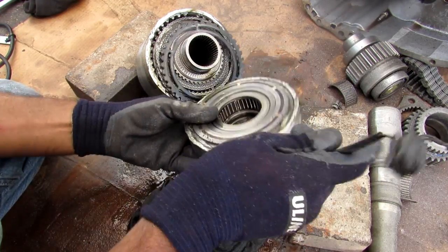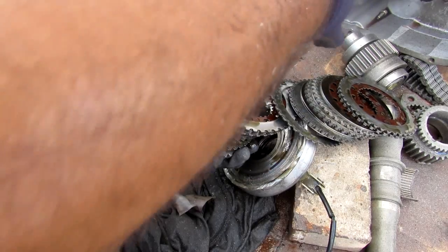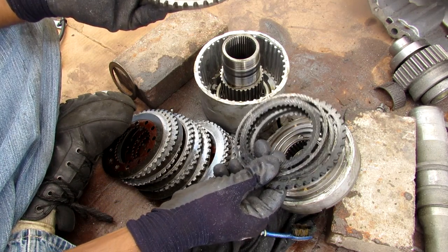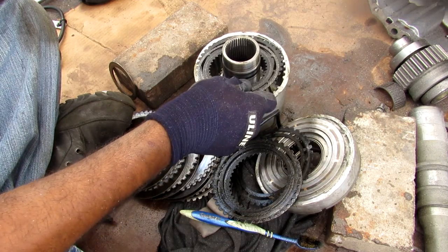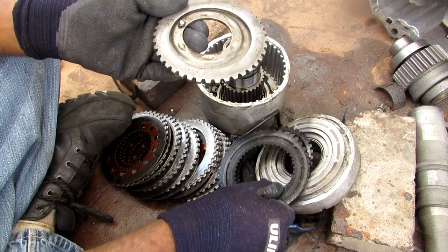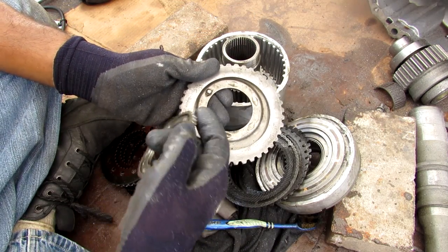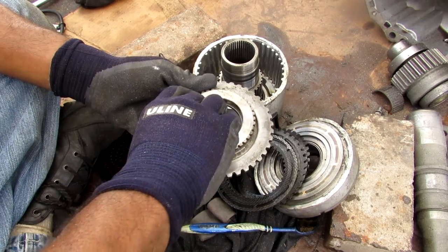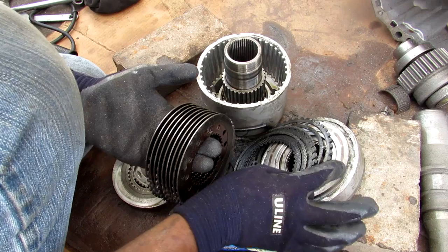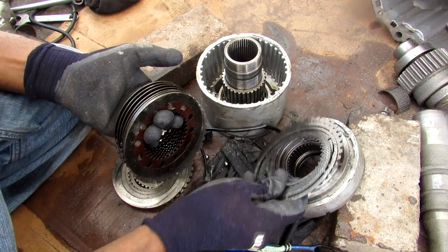This section looks like the clutch that actually does the activating because it has the wire attached to it. Here we've got the actual physical clutch — turning it upside down to remove all the clutches. The way this clutch pack works: the electromagnet activates and applies pressure. We have these control clutches sitting in front of it — some are externally splined, locking to the output shaft housing going to the front wheels; others are internally splined to this small ring. When the clutch activates, the output locks to this ring. But it's still applying pressure — and this ring has six ball bearings on the inside that allow this ring to rotate relative to the outer ring, which forms the front part of the clutch pack.